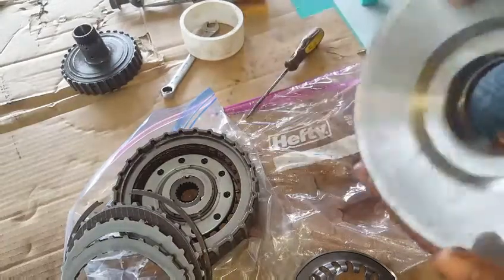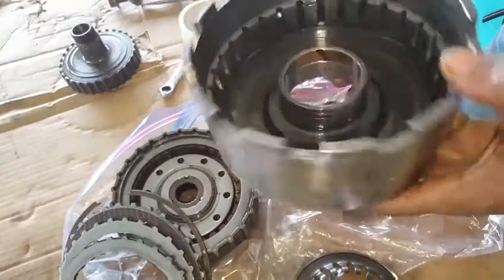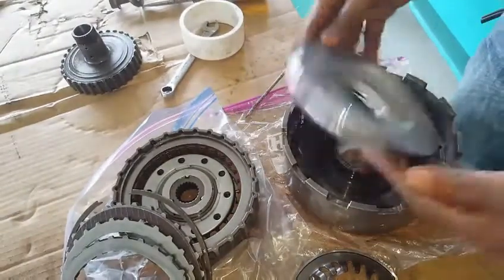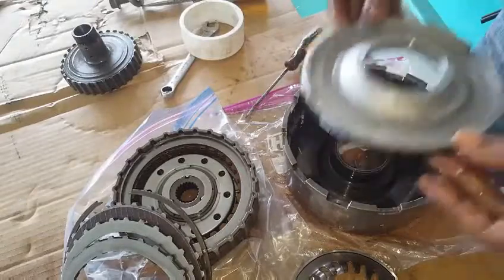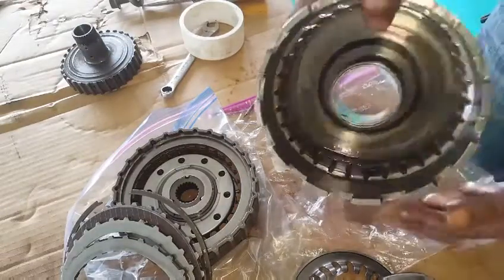You see the hole inside there on the back? That's where the hydraulic pressure is applied — the fluid in this chamber pushing this piston forward, locking the liner. That action is back and forth because you have the spring that will push it back.